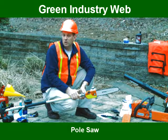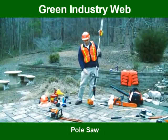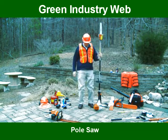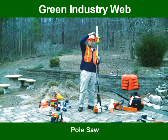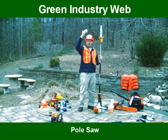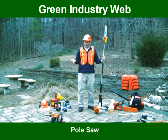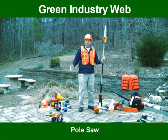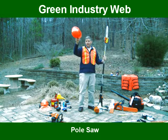Next, we're going to talk a little bit about operation on it. When operating an extended pole saw, as you see this model, I'm 6 foot tall, it is taller than me. They make some models that extend 13 and 16 feet. Well, obviously we had discussed in earlier sessions, when operating cutting units above your shoulder, you must wear a hard hat.